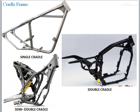From the head tube, a single tube may go towards the backbone, or two individual tubes may go, or a single tube from the head tube splits into two tubes after some distance. On that basis it is called single cradle, double cradle, or semi-double cradle. Single cradle means only a single tube goes towards the backbone from the head tube. Double cradle means from the head tube itself two separate tubes move towards the backbone. Semi-double cradle means a single tube runs for a certain distance then splits into two separate tubes and connects to the backbone.